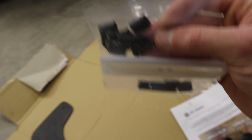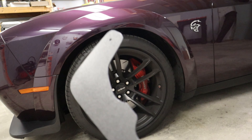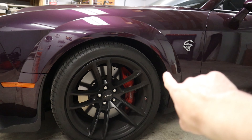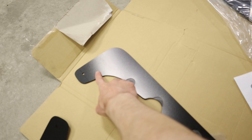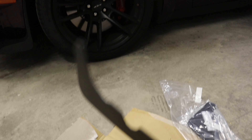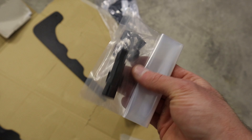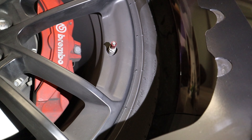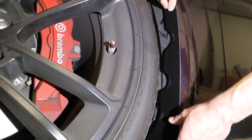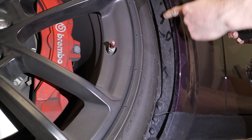There's actually no rhyme or reason between the same model vehicle — Dodge being kind of funny there. In this bag there are also two screws you can use for this installation, but you do not need to screw into the fender. You can just use the clips they provide and it should clip right into the edge of the fender. If you want added security so it doesn't fly off, you can screw these in. The screw hole is right here at the bottom, going on the bottom edge closer inside of the wheel well. I'm probably not going to do that unless these are really loose, but we'll see how the installation goes.